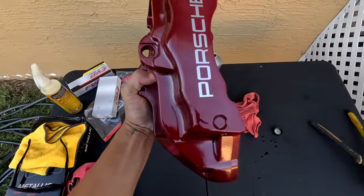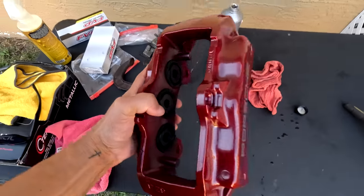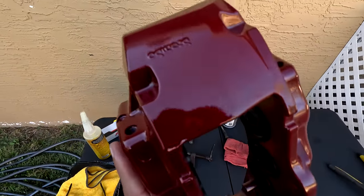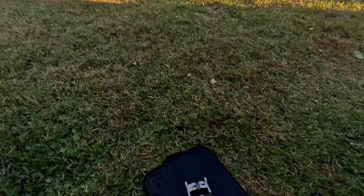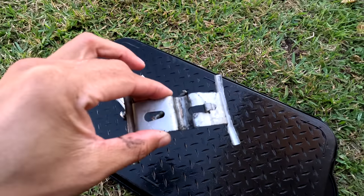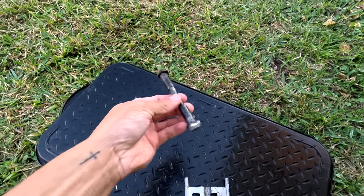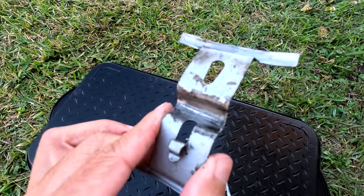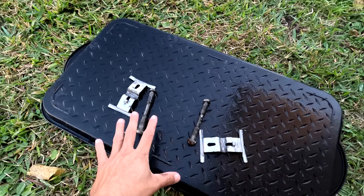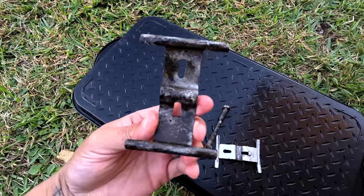Next: get the retainer clip that holds the pad, and the slide pin, cleaned up — toss the pads in and we're pretty much done. I might wait until tomorrow to put on the lower crossover bar so it's fully dry, but today seals are done and pads will be in. I realized the accent pieces were actually painted silver before — under all the brake dust — and now they look pretty worn. So all the accent pieces on the caliper are going to go gloss black — I'll paint these and reassemble tomorrow.